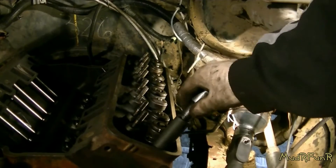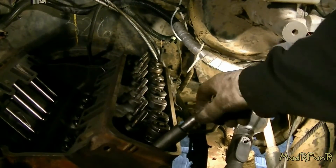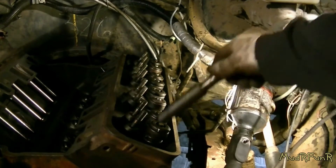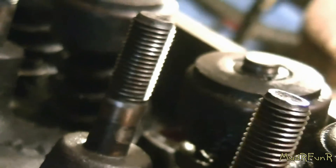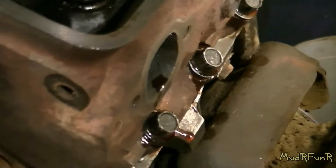What I'm doing now is tightening all the bolts down until they're almost touching the head. The reason for that is you're supposed to drip some engine oil in between the bolt and the head, so that when you go to torque it you get an accurate torque. Spray a little bit of engine oil all the way around every one of those bolts. I know I'm cheating — I'm using transmission fluid — but that just happens to be what's in my can. I've dripped some oil around all the bolts, the inside ones and the outside ones.